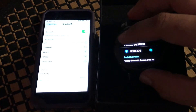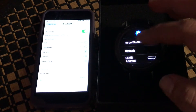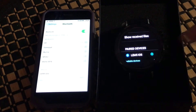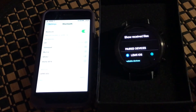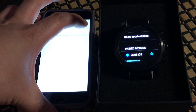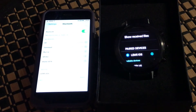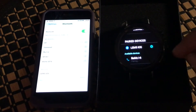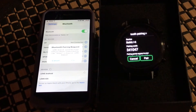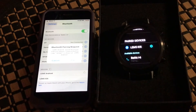On the phone, go back to Bluetooth and refresh it. In a moment you should see the iPhone appear under available devices. Once the phone's Bluetooth refreshes, we're going to pair from the watch to the phone. It prompts you to verify the codes match — confirm on both devices by pressing Pair.